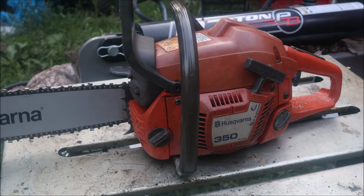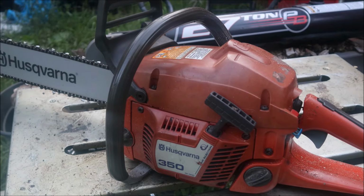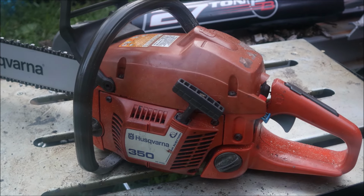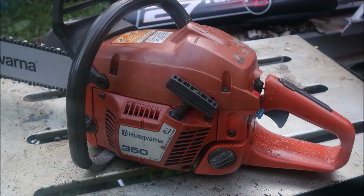But there you have it, guys. If you can pick one of those up cheap, just kind of copy what I've done there, just clean up. And again, when you clean up a port, polish it, it's gonna make it bigger. I did widen it quite a bit, not to the max or anything, but she was widened. Intake port, kind of done my deal there I normally do.